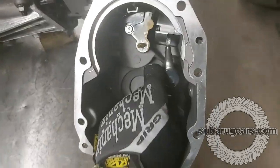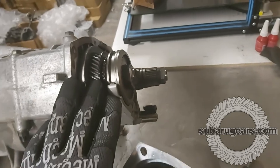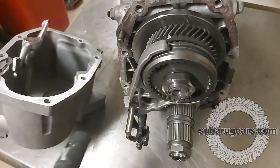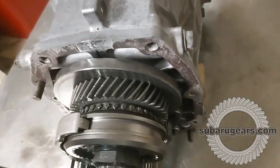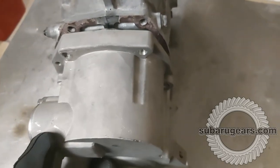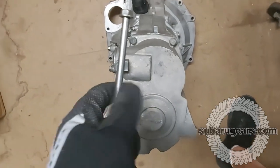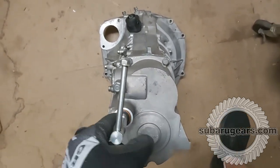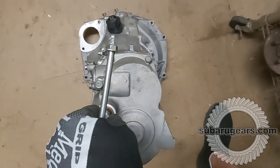Now is the time you may want to fit it to the transmission before pulling apart, just to make sure things shift correctly if you're new to this. We've selected fourth gear, assembled the supernose and shifter, inserted the hockey stick into fourth gear, slid the assembly on over the pins, and bolted it up to test. With the transmission nosecone bolted on and on the ground, we select gears: third, back to neutral — testing the three gates — first, second, third, fourth, fifth. Won't select reverse without going to neutral first, then select reverse and you can hear the straight-cut gear engaging. Back to neutral, back to fourth. Now we can unbolt it.